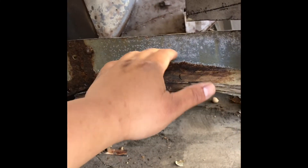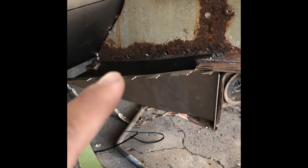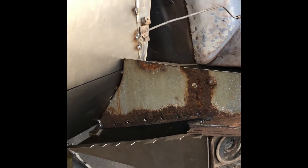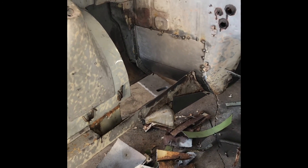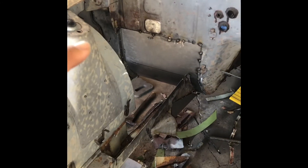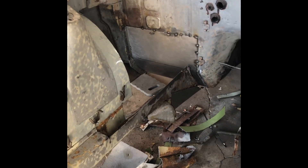The only reason why I didn't want to replace this whole engine bay frame piece right here is because I was afraid it wasn't going to line up. I've seen some people do it, but I figured most of my rust was up top anyway. So I'm just going to clean up all these rust areas and try to save this piece right here. Getting closer to finish, and it's starting to look a lot better. It's not as hard as what I thought it would be — you just got to go out there and start cutting things up and start measuring things. I'm using 18-gauge, so it is slightly thicker than the 20-gauge, which is a little harder to bend, but I feel it's a lot better because it's the firewall. Thank you for checking it out.